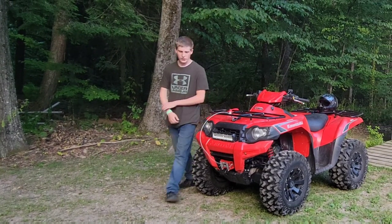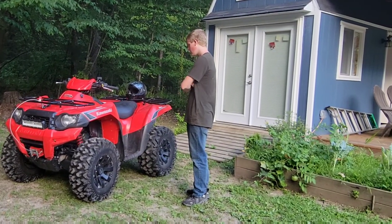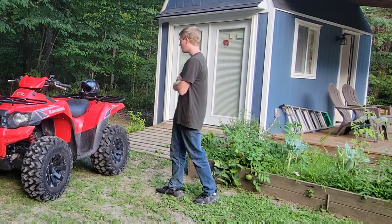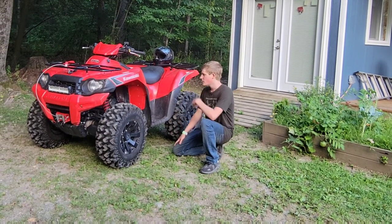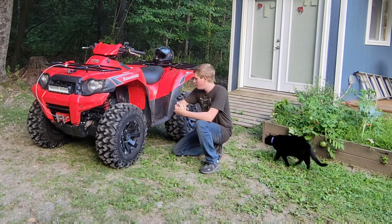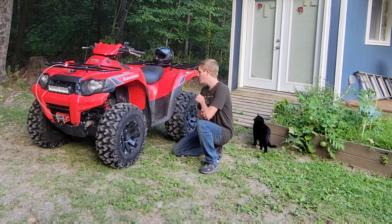And I checked the oil, and it's not leaking. Everything seems to work A-okay, guys. It's got nice tires. It climbs right over logs. No leak, no drip. That was fixing the stator cover. I learned quite a lot. I fixed the stator cover, the stator gasket, the stator wires, the grommets going in, sealed that off, got a new gasket, got a new water pump seal and bearing and outer seal,